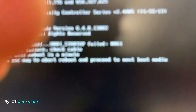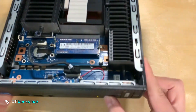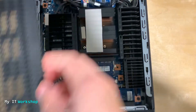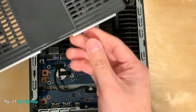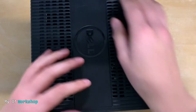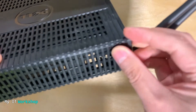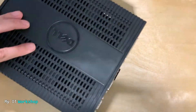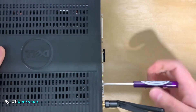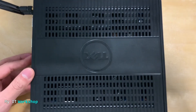It's working now — we can see it's showing something on the screen. It's turned on and not blinking anymore. Our final step is to put back the cover, so I'm shutting it down by pressing the power button. I take the cover and make these two ledges go below the metallic clip, make sure it's tight, then put back the screws. One screw fell to the ground and I couldn't find it during the video, so you'll see me putting back only three screws — I'll find the last one after recording.